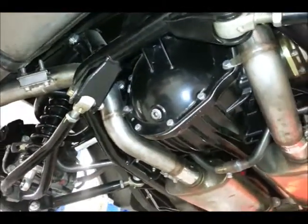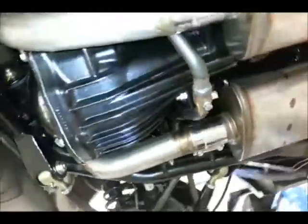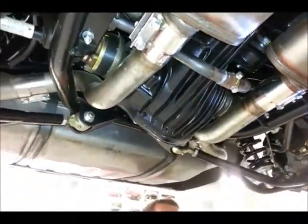It uses Dana 60 ring gears, which is almost a 10-inch ring gear. And the ring gears are actually still manufactured by the OEM, so they are very, very quiet. So you eliminate some of the NVH that's become an issue with the aftermarket 9 inches and whatnot.